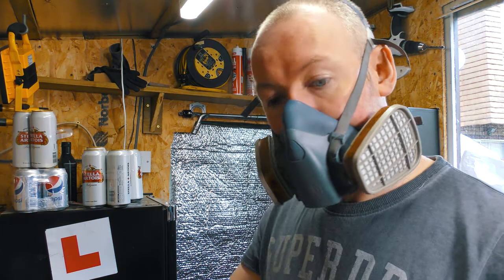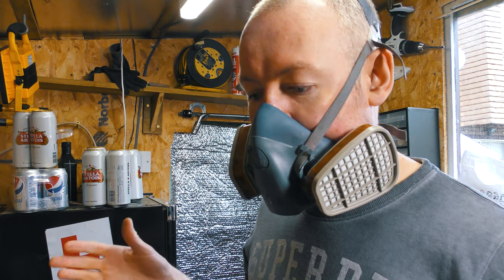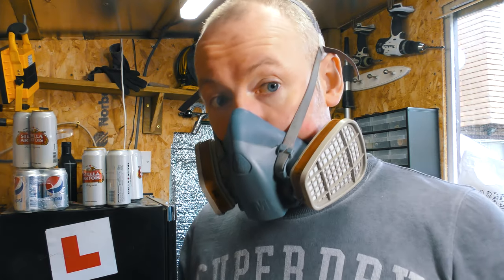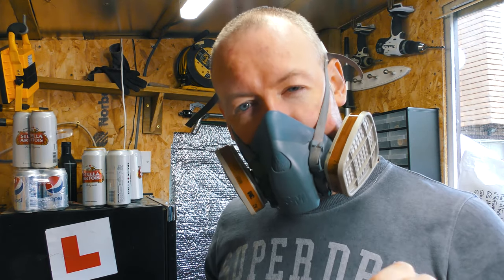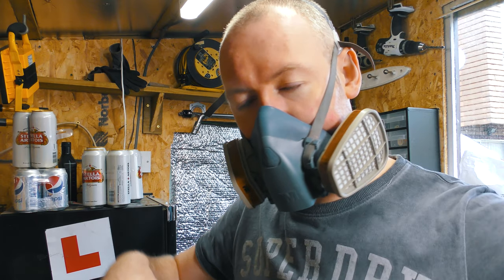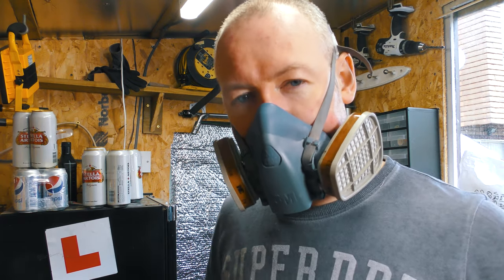Alright, so now I'm going to have to make a mould of the hood scoop in fiberglass and then mould out my carbon from that. Which means we might actually be able to do, like, forged carbon fibre, where you cut trimmed pieces and you can press it all together. I don't know. We'll see. We'll see what we do.